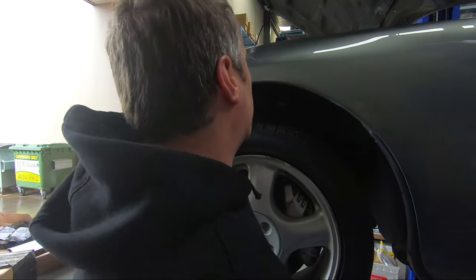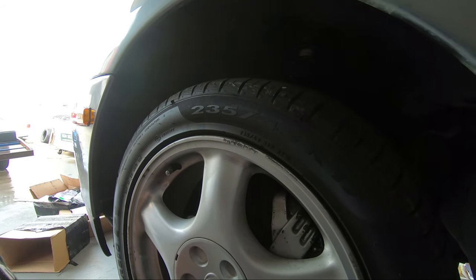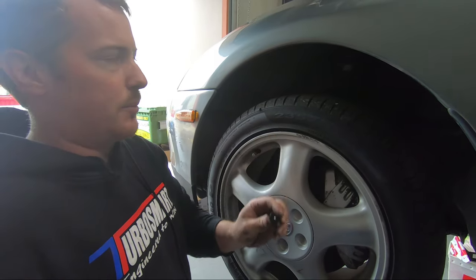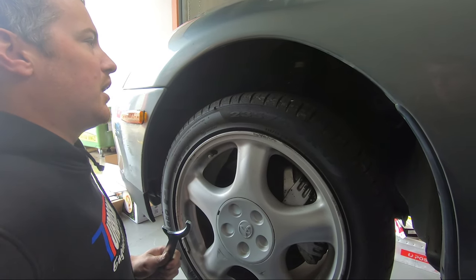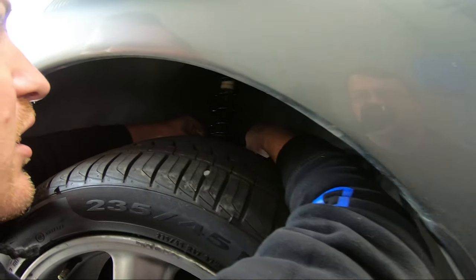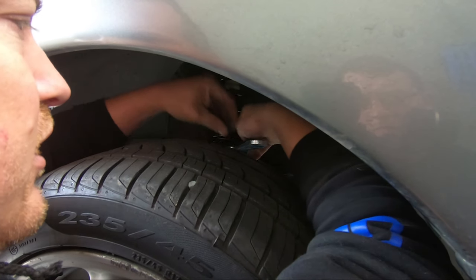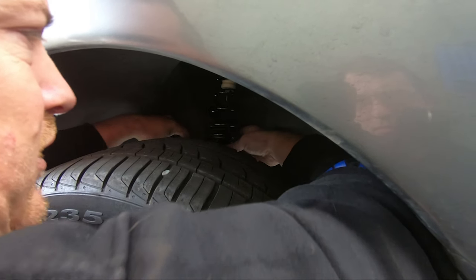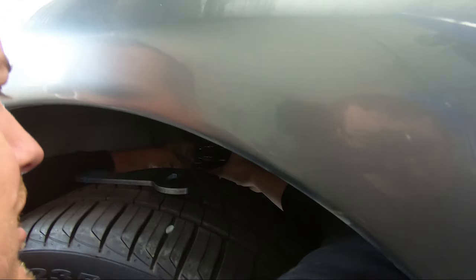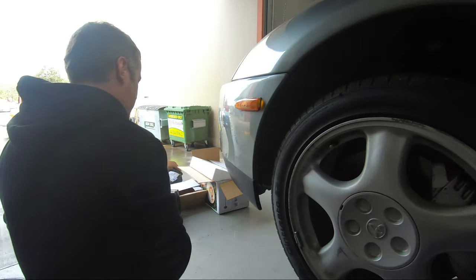We're gonna change the height slightly. So on the Essentials, there's only one adjuster seat that has a little locking Allen key. Use this, not an Allen key, because you don't want to do it up overly tight, just tight enough to stop it spinning. So we're also going to count how many turns we go down. I think we worked out we're gonna go about 3 on the front. Every time the Allen key comes around, so that's 1 and 3 will be over there where it was. Do our adjuster back up, and same on the other side.